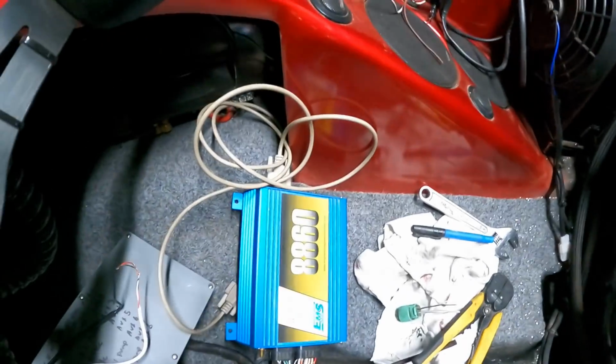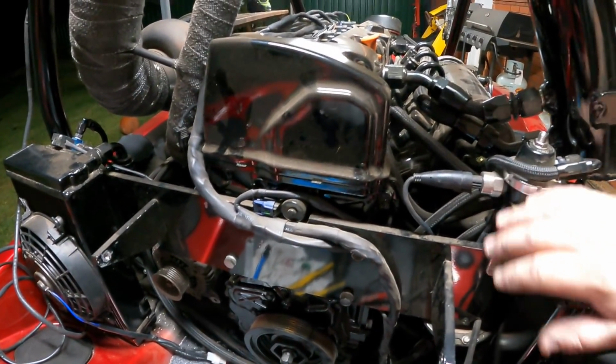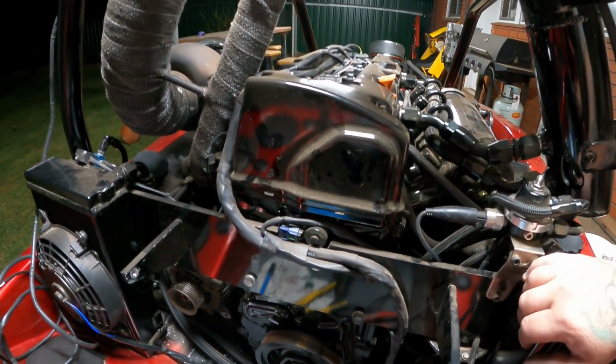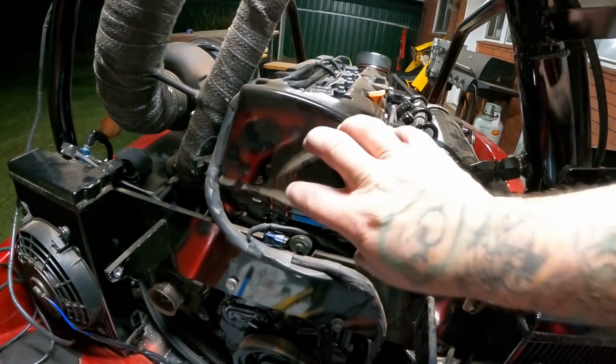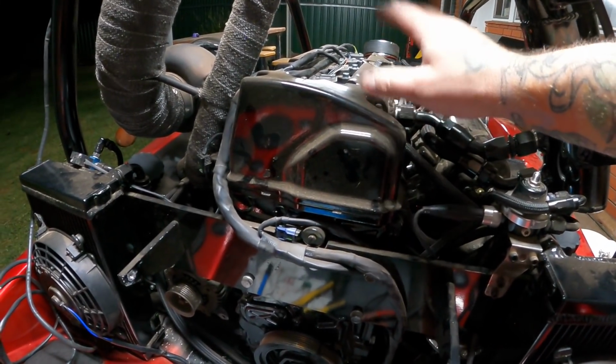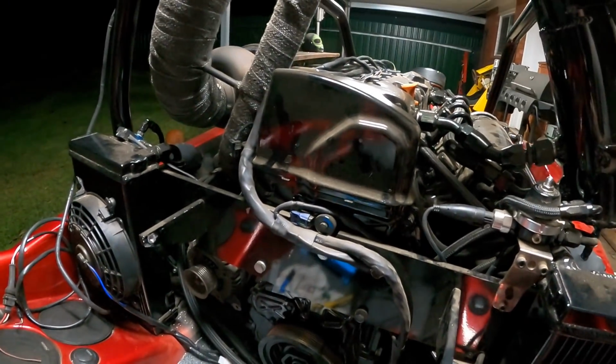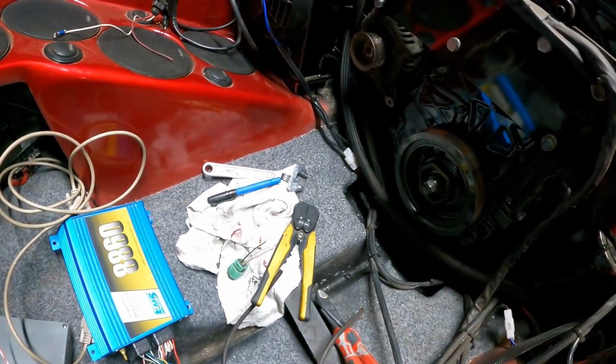And that way, this ECU starts it up now, but it will do funny stuff when I'm driving, because it wants to vary with the oil pressures. It wants to vary the timing, which we need to lock. So we just run a base timing, and the ECU will now control the timing. So VTC, without going into too much detail, is just an adjustable timing all over the rev range to get the maximum horsepower and torque when driving.